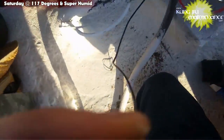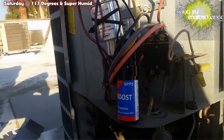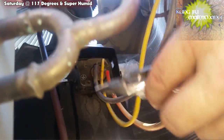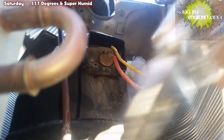I just got shocked on this wire right here — got me in the elbow. I can wrap that with electrical tape; it's just low voltage, thank goodness. I believe what's happened is we've lost continuity at the terminal. I'm going to pull this wire and pull the lead off.